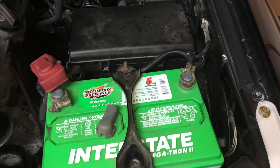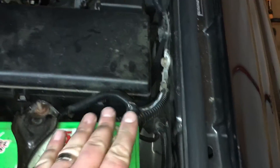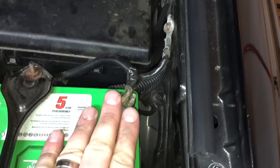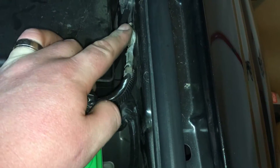What we're going to do is upgrade this wire — we're just going to add a wire between our ground here and our negative on our battery terminal. We'll probably take this off and clean the paint really well so it's an even better connection.